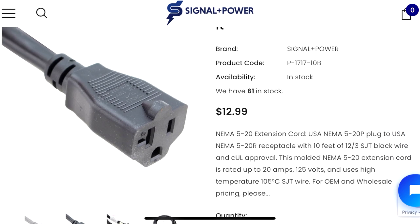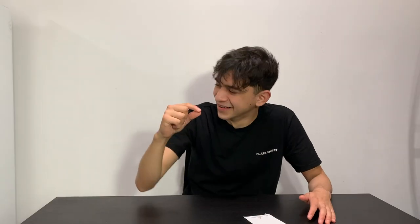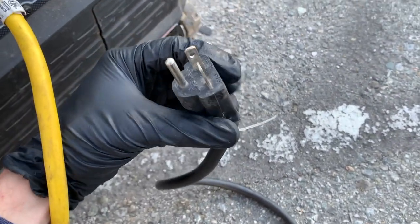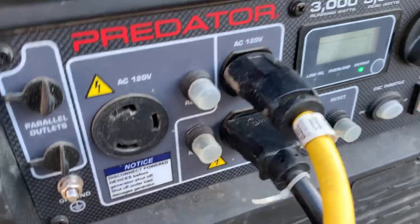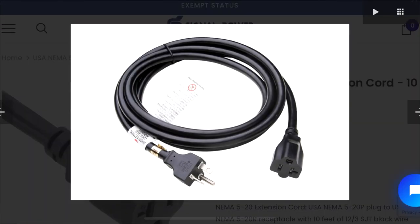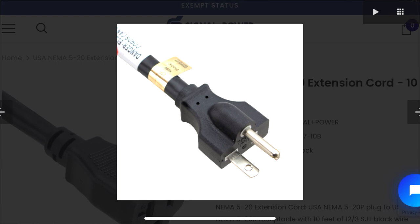In the La Marzocco GS3 specifications it says 15 amps, but max 20 amps. What that means is once it hits the boiling point — about 200 to 205 degrees, which is what you need to brew espresso — it's going to hit the 20 amp mark. So once your espresso machine warms up to 200 degrees, it hits 20 amps. That 15 amp cord is not going to be enough, your machine will just shut off and start to smell like smoke.